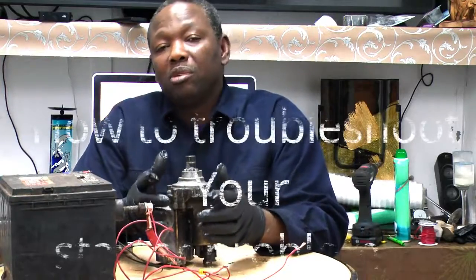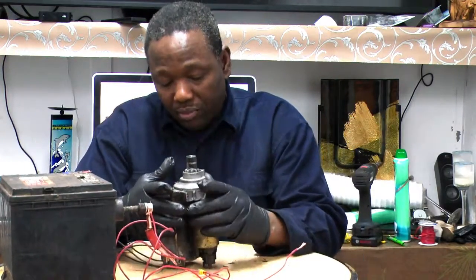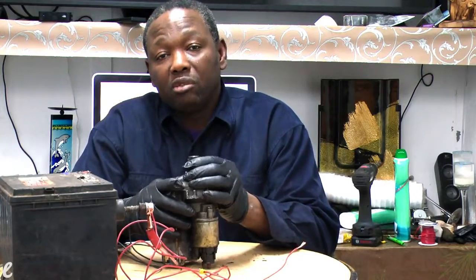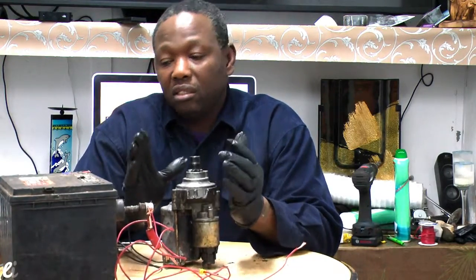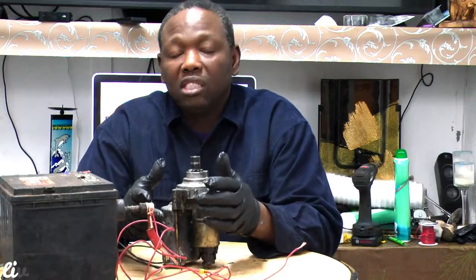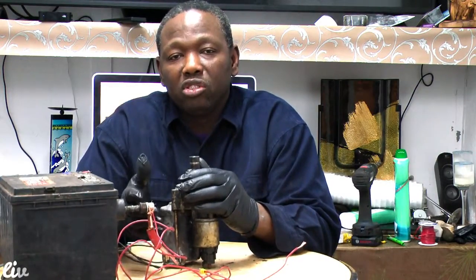Today I'm going to be talking about problems with your starter and how to diagnose the problem. Okay, so the first thing, before you think that your starter is not working, you have to make sure your battery is 12 volt and your battery is fully charged before you can come to the conclusion it's your starter. And what you're going to see is, you turn your ignition and nothing happens, the engine doesn't turn.